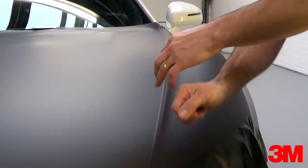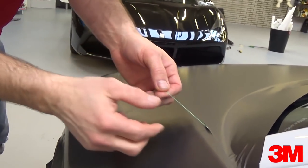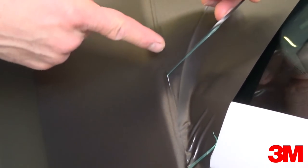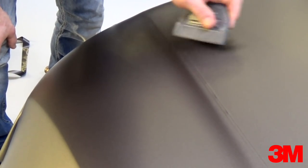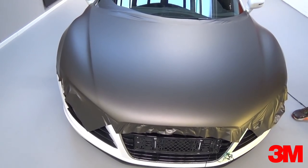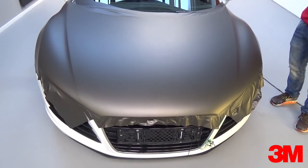And here's how it should look when completed. Repeat the exact same steps for the other side: release line 1, remove the inside tape, then remove the outside tape and material, lightly squeegee together, heat, and seal to create the perfect butt joint. And now this is the halfway point — three panels with a butt joint along the symmetrical body lines.